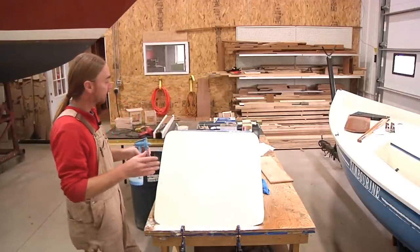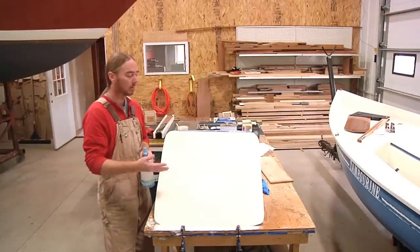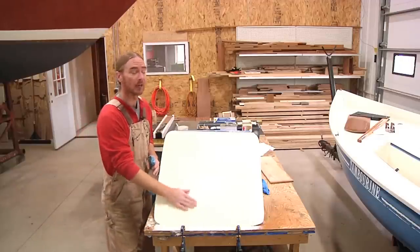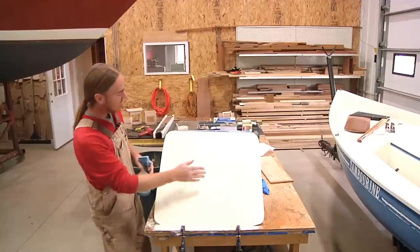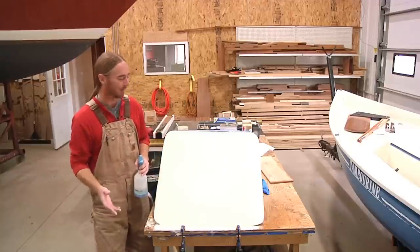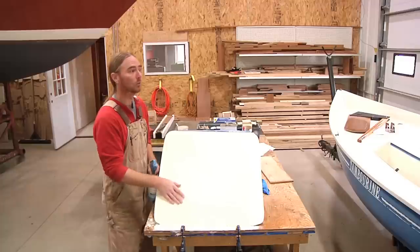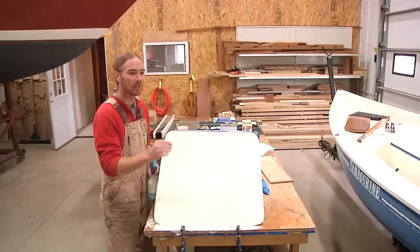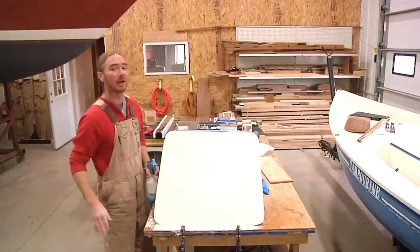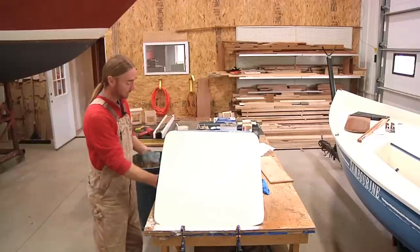All the edges are tapered off. When you're doing this part of the process, your fingers will tell you a lot more than your eyes will whether you've got the edges tapered off. Looking at it there's sanding residue all over, you can't see it — but if you run your fingers over it you will feel every little blemish or imperfection. Your hands are a lot more accurate than your eyes at this stage.